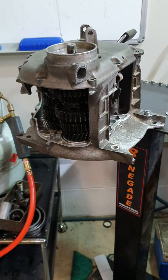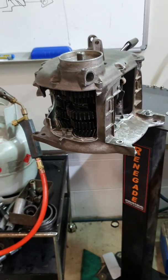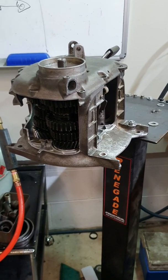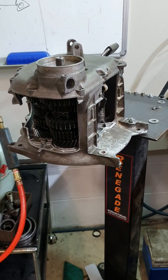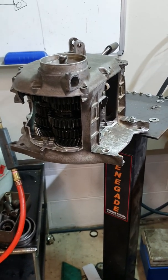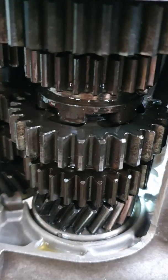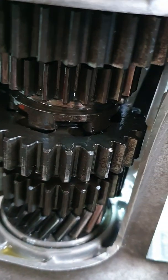I've tried 75-90, I've tried 80W-90 which is what's specced in the owner's manuals in this country. I find in my own bike that in hot conditions - traffic, start-stop, out in the outback where temperatures reach 40-plus degrees - if you use a multi-grade oil, after a while when they get hot you can hear them. I believe that's because the lighter grade oil is reducing the cushioning effect between these big heavy gears turning all the time. There's a good shot of the dogs and the holes - I think that's probably second gear.